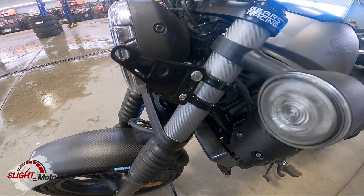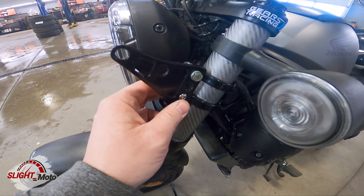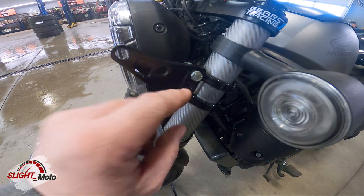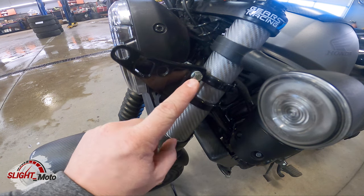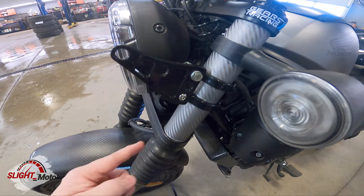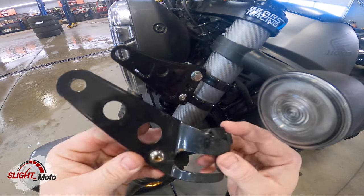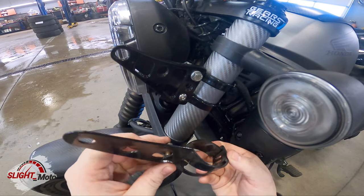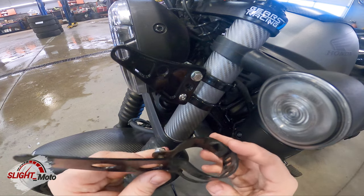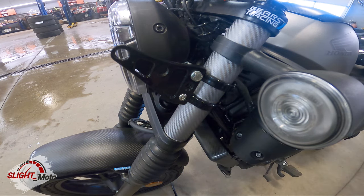These are the brackets I'm using — I'll link everything in the description. The problem with them is they're aluminum, and if you tighten them too much they'll actually strip. That's why I ended up using longer bolts. I keep the old ones at the back but I extend them so I can put a nut and a lock washer at the back. I believe the measurement is 70 millimeters. Originally I used universal clamps — they're metal but coated — but they didn't really fit well. These new ones look a bit cleaner and should work a lot better.